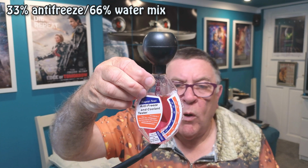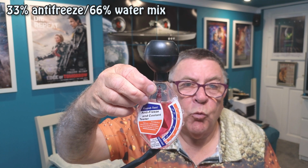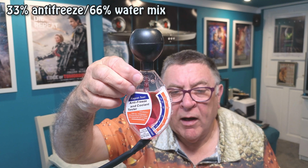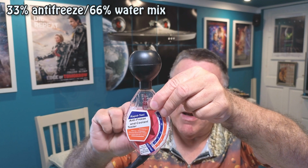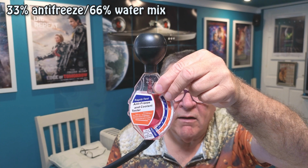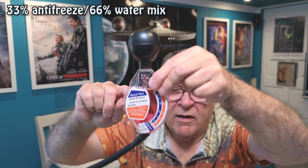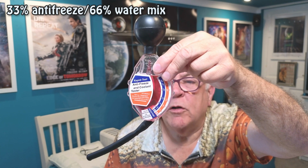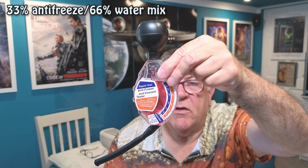But even though there's twice as much water in there, 2 water, 1 antifreeze, where the first one was 1 water, 1 antifreeze, it's not a lot less. It's just dipped down by about 5 degrees or so. But again, I've tapped and tapped, but sometimes there are micro bubbles on there which will affect it a bit. A couple of squirts it took me to fill that, holding it at an angle, with dripping coming out the end and the chance of little bubbles, but it's still giving you an indication. So you can see it's higher than pure water, which was right down at the bottom, and obviously less than neat. So let's try the refractometer now, and I'll show you how that is.